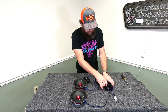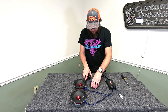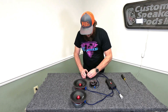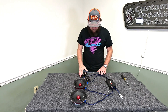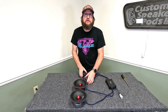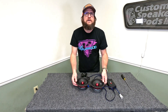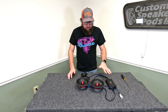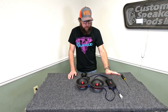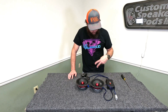And there you have it. We'll lay this out to make it easier to see. That's it — basically all we've got here. Dual six, dual tweeter, wired in parallel through a passive crossover. Plug this into your door and jam.